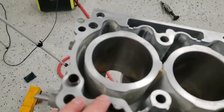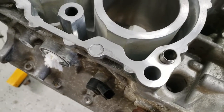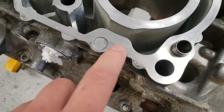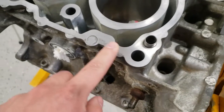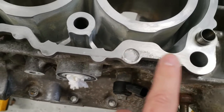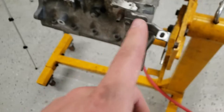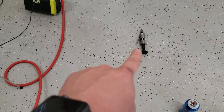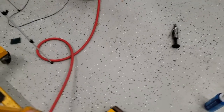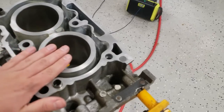Okay, there. This half is done. And as you can see, there's some parts that I think are exposed outside. It was hard to tell with the head gasket on, but that didn't want to clean up very easily. So I just cleaned them up as best as I could by hand on the head gasket side, just in case. On the other side, sometimes those parts I would hit with this air disc right here, which I don't recommend you using one of those to do like the whole head or something. That would actually wear off a lot of the material. So definitely do this by hand.